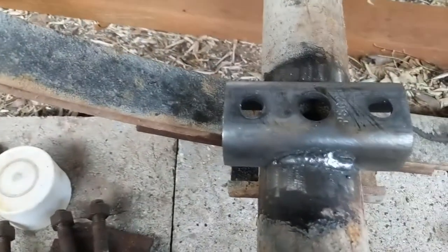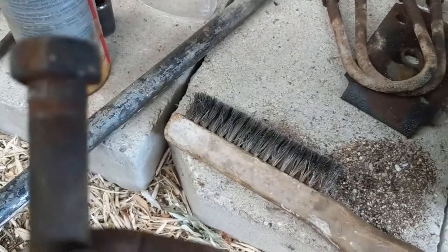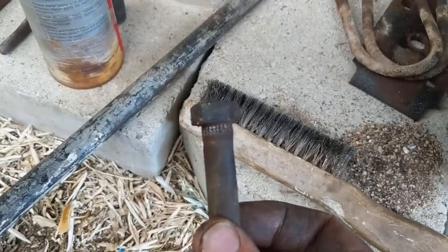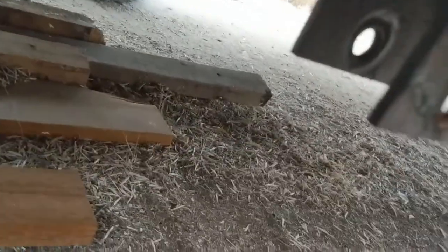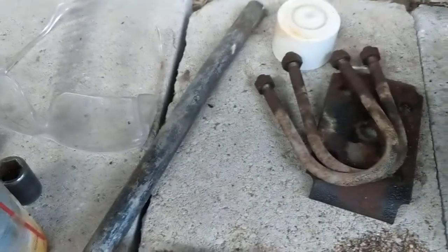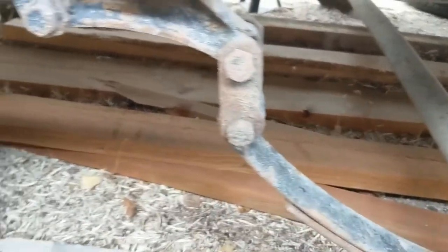There's the last perch welded on. My welding is not terrible — it's not the best, but it's not terrible. There's the bracket that the spring fell out of. This is the bolt — there are splines, and when that bolt is driven back into this hole, there are splines. That's what the finished weld looks like, and this is what it all looks like taken apart with the new perch and the parts. Probably leave it at that, although I'll maybe add a road test.